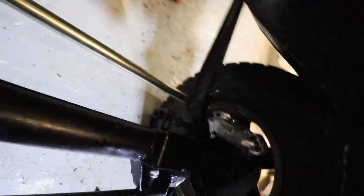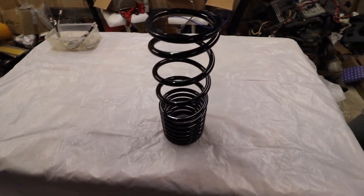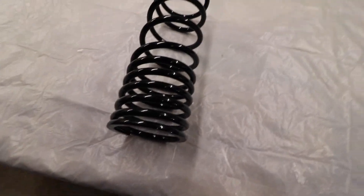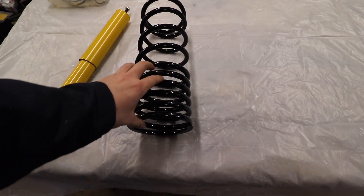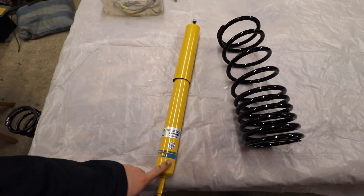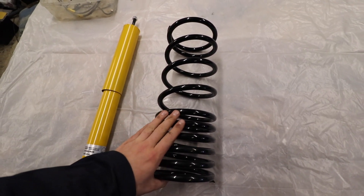In the meantime, I'm going to be fitting new bump stops to the car. I've already got that side loosely fastened on. The next step is to take the wheels off and put the new springs from Springtool Limited. We've got progressive front springs and they're going to be paired with a Bilstein B6 shock absorber damper. The progressive rate of the spring has been tailored to these shocks.